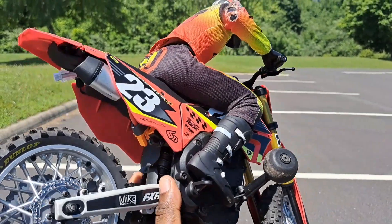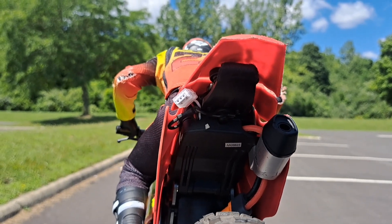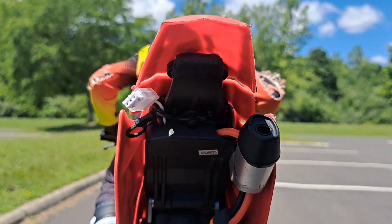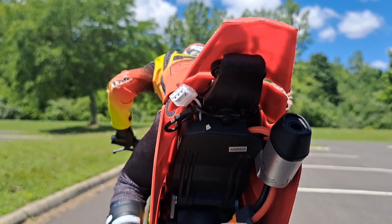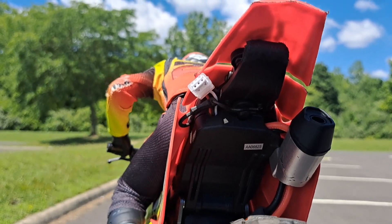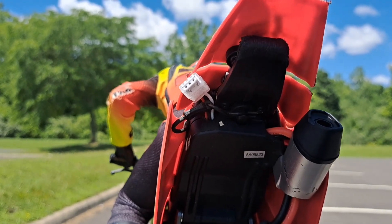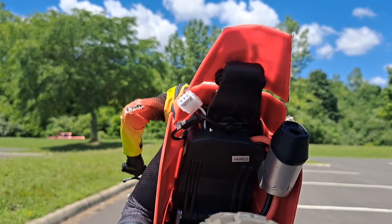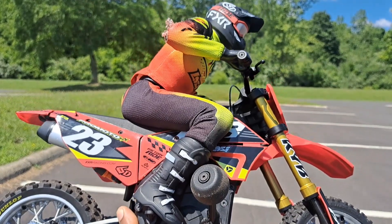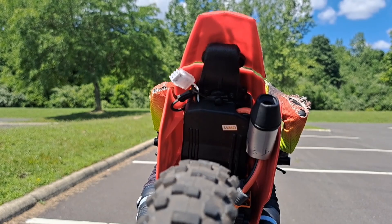Alright guys, I forgot to show you something before I started the video. I was having a major problem trying to get my balance lead to tuck under and over to the right, where the opening is where you plug the battery into the bike. So I did a quick, cheap, easy mod — I just took a Dremel and dremeled out just a little bit of the battery tray so I can keep my balance wire on the left side. When I close the battery tray, it is not pinching. Something you guys can do to your bike so you can use your original batteries and not have to worry about running out and buying batteries without the balance lead.